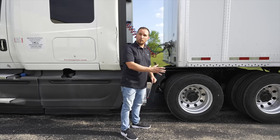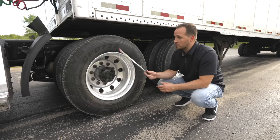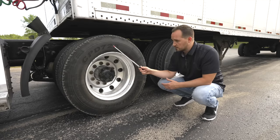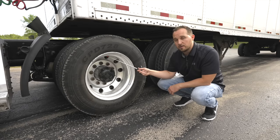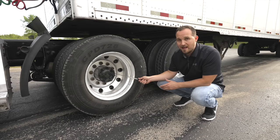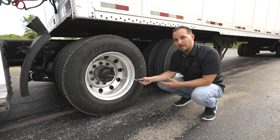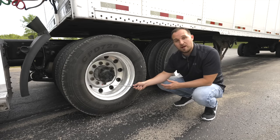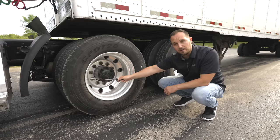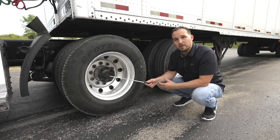Now we're going to check the sidewall of the tire and our wheel area. The sidewall is not broken, not cracked, on secure, no cuts, no leaks. Our rim is not broken, not cracked, on secure, no illegal welds. Check all our lug nuts — make sure they're not broken, not cracked, on secure, and not loose or missing. Our axle seal is not broken, not cracked, on secure, all bolts are on tight, and there are no leaks under it. Our valve stem is not broken, not cracked, on secure, with the cap on tight. I would check the valve stem with a tire gauge to make sure there is at least 105 PSI of air in my tire.